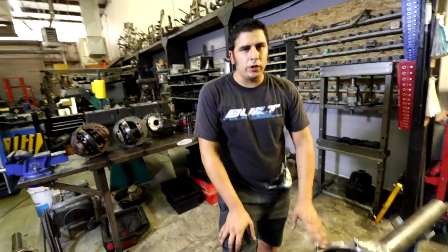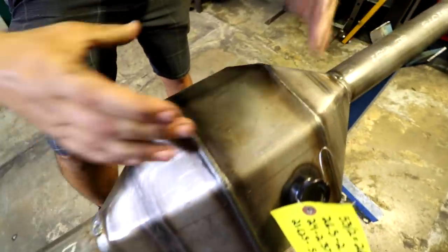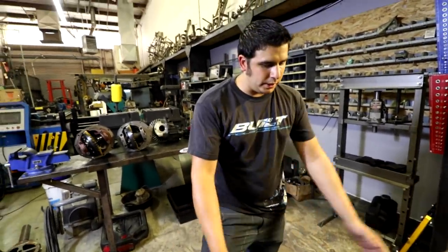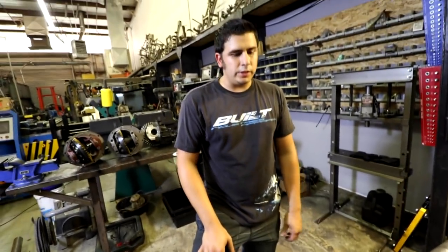Also, they make what's called a banjo and a centurion style housing. If you go to the junkyard and look for housing, the banjo style has a real small, rounded center section with tiny tubes on it. And then you'll see the centurion style, which tapers off real wide, similar to how this looks. That's the Torino style housing you're going to want to run. The stuff that was in the heavy duty, big cars, big trucks.